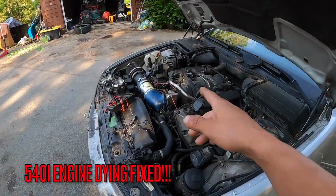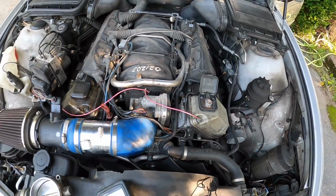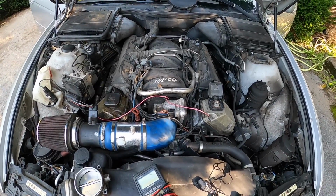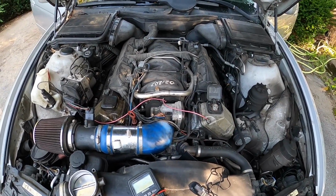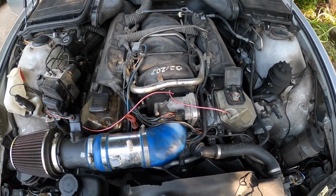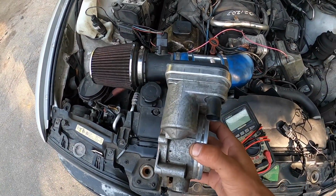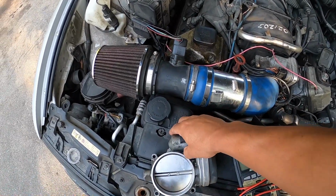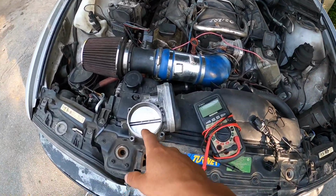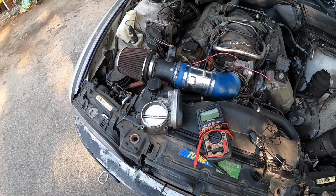So then I came out and we tested this throttle body by back probing. And when I back probed the throttle body, I was getting weird readings, not what they should be. So I then had the key on for quite some time. I noticed that the motor on the top of the throttle body was getting quite warm, and the car actually threw a code saying that the throttle actuator or whatever inside of this was sticking.